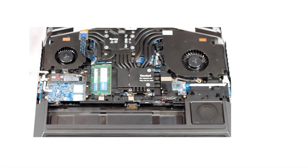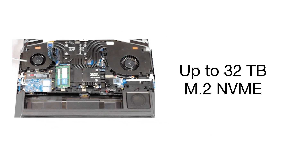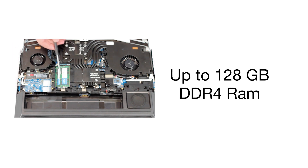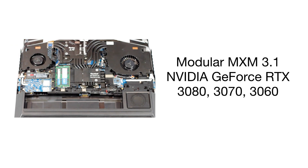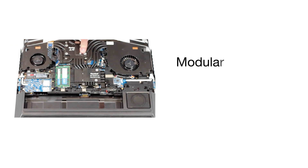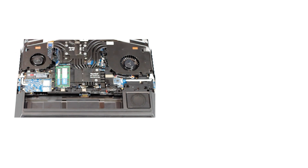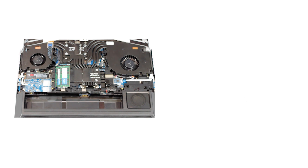There are three M.2 hard drives in here — there's a one terabyte M.2 Samsung 970 Pro — so you can have multiple hard drives lined up. These are two of the four RAM slots; two are here and the other two are underneath the notebook, under the keyboard, easily accessed. There's the video card covered by the heat sink, the processor also covered by the heat sink, and two fans that keep everything cool.